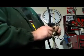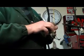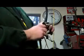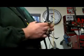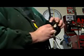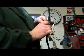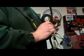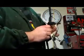So that basically joins the wires that were going to the voltage regulator. There was 2 lives and a field wire. So the cable that feeds the ignition light. Alternators won't work without an ignition light or without that circuit. So it just joins all those cables that were required to make the coils work before. Just join them together.